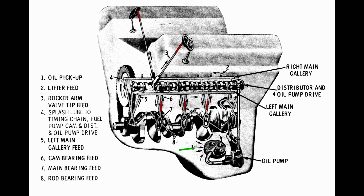So we're going to start off in the sump like we did before. You can see the oil enters the screen, goes through the pickup tube, and now the oil pump is going to take that oil, pressurize it, and push it through the system. You've got this passage that leads up to the oil filter — the filter is going to filter it, then it enters the block and reaches this intersection of passages. The first passage we're going to follow goes down to the main bearing, and then of course you still have the oiling out to the connecting rod. Notice at this point we have the oiling moving up to the rear main camshaft bearing with no restricting so far. We've got that main passage that leads up to feed the right main gallery, and as the right main gallery is being fed there are other offshoots that get fed at the same time.